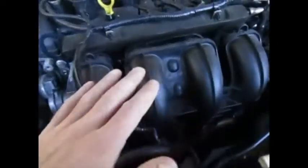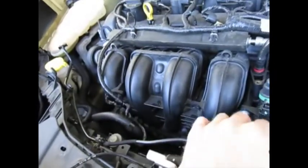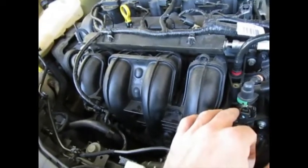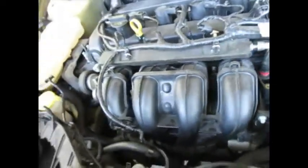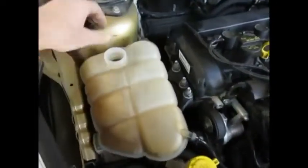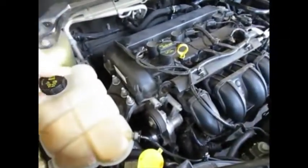This transmission has no dipstick — it's the 6F35 transmission. I probably would have put a dipstick in this design, but I'm not knocking Ford because I'm really happy with this vehicle. Keep an eye on the coolant reservoir. If you want to check your transmission fluid, you just have to let a little out of the drain plug.